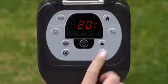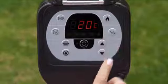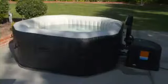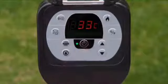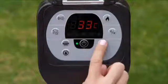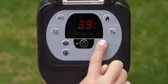You may change the display to Fahrenheit by pressing the Celsius Fahrenheit button. Before heating the spa, set your target temperature. Operating temperatures range between 20 and 40 degrees. We recommend you do not set the temperature above 38 degrees. Press the on-off button to turn the spa on. If the heater is on, you must turn it off. The heater must be off when setting or adjusting water temperature. To adjust the temperature up or down, press and hold either of the temperature control arrows. The display will flash as you adjust the temperature.